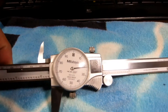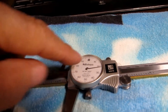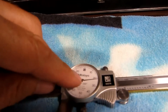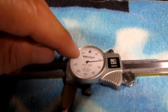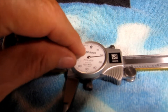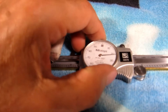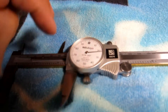Now here are the two main notes where I'm supplementing the other videos. You see this stuff here — don't take that off of there. The way this face comes off is you pop it up carefully with a screwdriver. But once you get that dial off, first of all it's hard to get off, and it's almost impossible to get it back on right. Also, underneath there there's a couple of gears with springs, and once they're removed the spring and preload come out. It's almost impossible to get it back on right. If you're having to take this apart, your calipers are probably scrapped because they won't repeat afterwards. Don't do it. Do not take this apart.